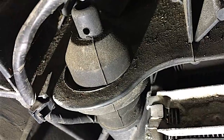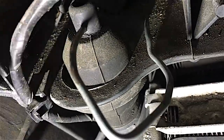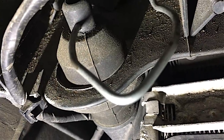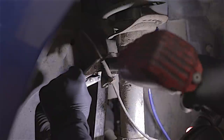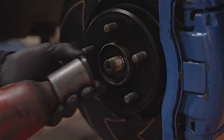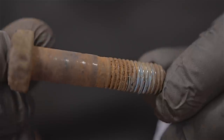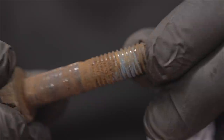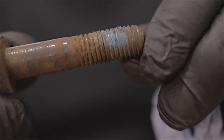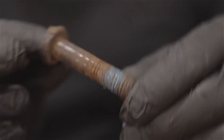Before I put this car back up in the air — I just remembered — you've got to pin these radiators up. That will hold the radiator from falling out when I take the subframe off. I don't think this car's ever been apart before — these are the bottom ball joint bolts and they've still got the Loctite on them. I'm going to clean that up and get some grease back on them.